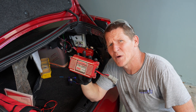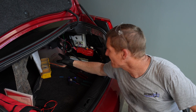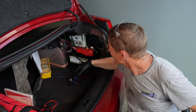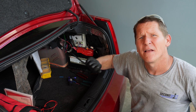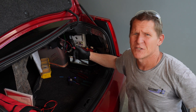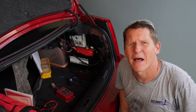The right answer when you have one of these is: you can't take the power for this controller from the always-on wire, but you can run a relay — and I have one right here. We've run the relay to that battery power wire, but the coil side of the relay is connected to the ignition voltage at the fuel pump control module. So when the key turns on and the fuel pump control module wakes up from ignition voltage, the relay closes, sends power to the MSD controller, and it works exactly as originally intended — but it will not kill the battery anymore.